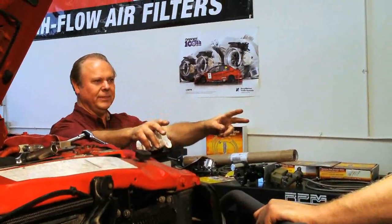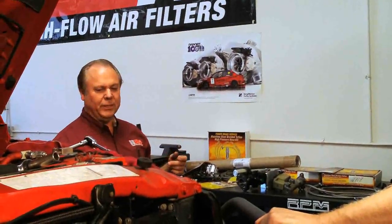Motor homes and heavy trucks — you want full pressure over your line. Picture drag racing: when you drop the clutch, all the horsepower goes through the leaf springs or the arms, all power pushes the frame forward. When you apply the brakes, you want the rears to pull the frame back. If you put 80% of the pressure into the front, the vehicle wants to toe out. That's why you have toe-in on alignment — to allow for the rubber flex. Because as soon as the vehicle goes into toe-out, it wants to dart. So I always like to put as much rear brake on the vehicle as I can, which also takes the heat off the front brakes. Most cars, the front wheels are black with brake dust because they're putting all the pressure in the front. We do it mostly with trucks and motor homes.